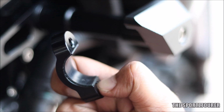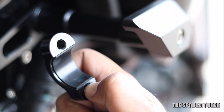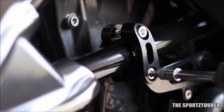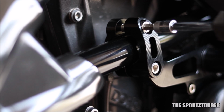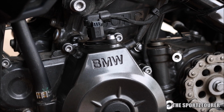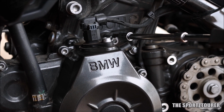I liked the attention to detail where the inner side of the C-clamp holding the chassis tube has a layer of soft rubber which won't damage or chip the contact patch on the chassis. We already spoke about the torque requirement, but it is equally important to sequence the fasteners for proper fit and alignment. Switching sides, we have a similar installation procedure where we begin with the 2 hex bolts on the top of the magneto case.